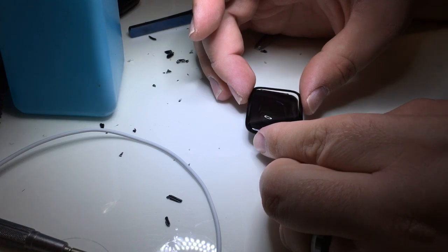I do it correctly, I won't have any bubbles entrapped in the Loca, and therefore under the glass. And getting those bubbles out is a pain, and typically means I have to lift the glass again and do it all over again.